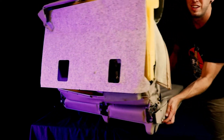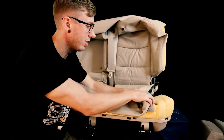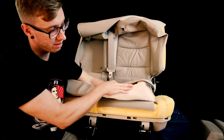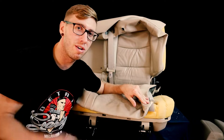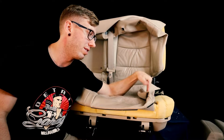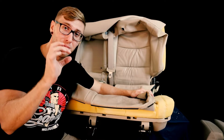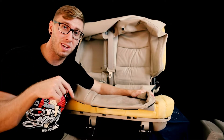Just going to go ahead and start removing more stuff here. After looking down in these edges here, I realized that there's some sort of a clip mechanism. There's a rod going through the foam, and there's a rod that's kind of fed through this seat cover. There are these things called hog rings, and what they are is a little ring that holds the two rods together, the rod that's on the foam of the seat and the rod that's on the seat cover, and that keeps a nice taut seam for any upholstery. We will need to use some hog rings and some hog ring pliers, which I just ordered off of Amazon. Luckily on Amazon, I'll put the link in the description.